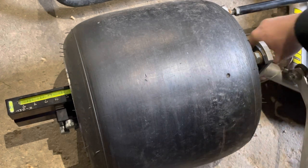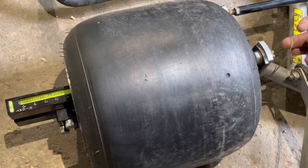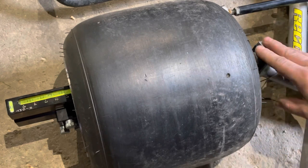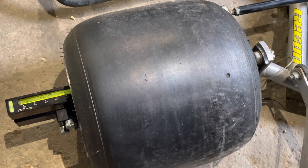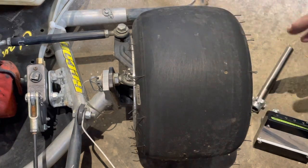Make sure that you can get your cotter key back through this hole for safety reasons. I also like to take a piece of safety wire through the bottom and top so that neither one of these bolts — your front end — isn't going to come apart on you at high speed. We'll switch the angle over to the other side and I'll give a quick demonstration over there. Now we are on the left front. I may not make an adjustment — I just want to show you how the bubble would move.